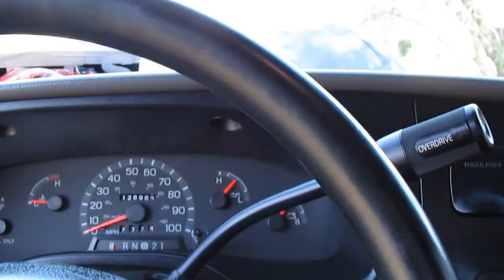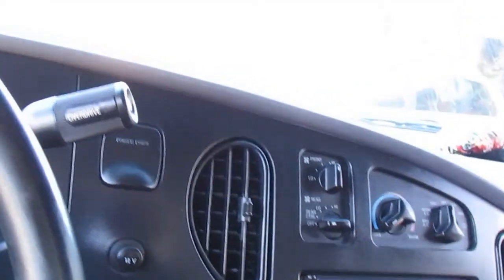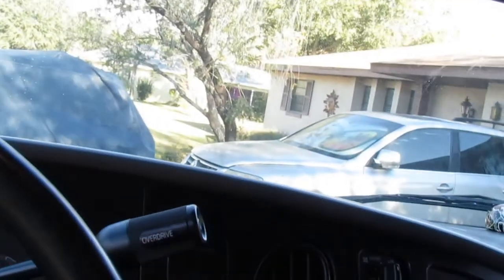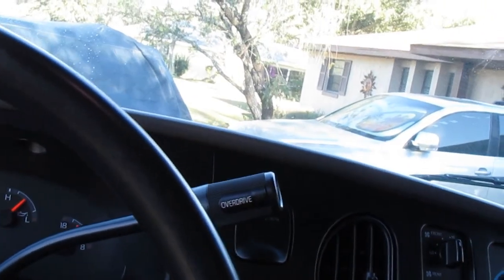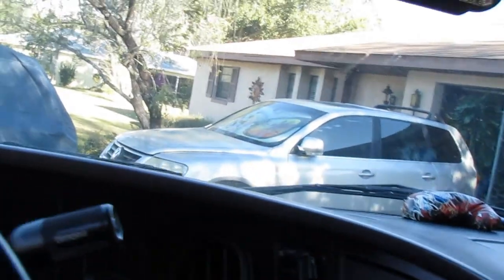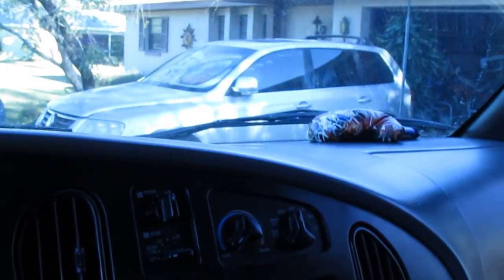Starting with maintenance: I cleaned out the air conditioner, cleaned out the condenser, and cleaned out hair and various debris. Now it has fantastic flow — ice cold or nice and warm. You also have the roof air in the back, but that's 110-volt. Between the two units you can run the cab unit with the back door open and get plenty of cooling effect in the front cab.